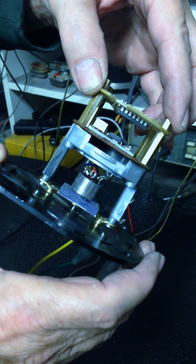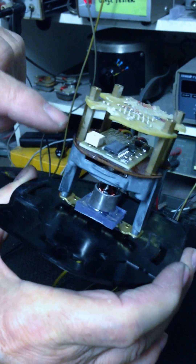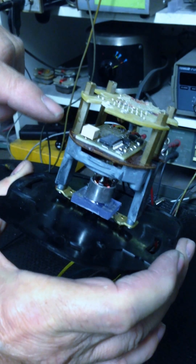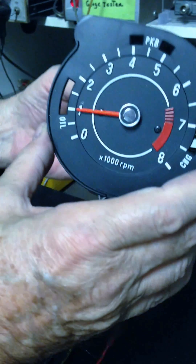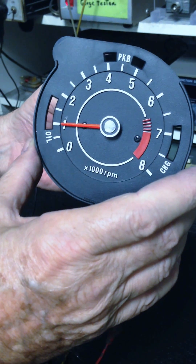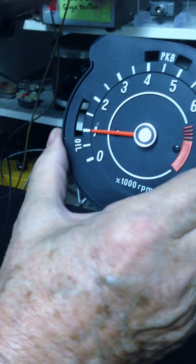It's a bi-coil, four-pole, very, very fast — much faster than the stock original. And then we take our circuit board, which we've designed right here. We can get that to fit just about anywhere inside a tach, keeping everything looking stock and original so that no one can tell anything's been changed, and they're very fast and very accurate.